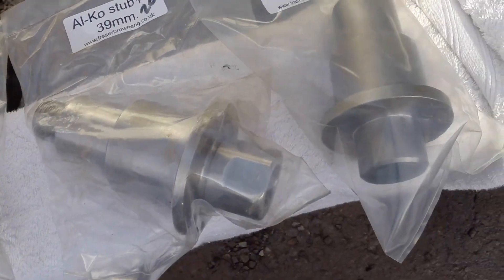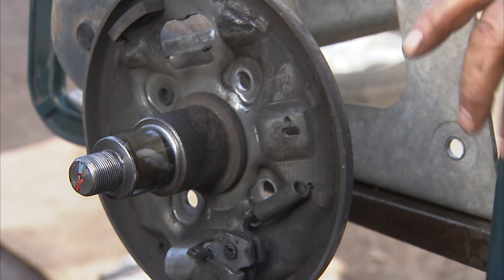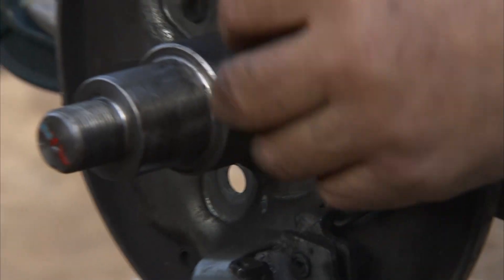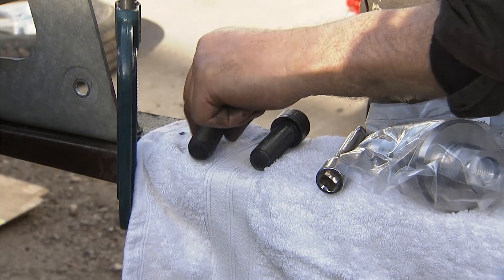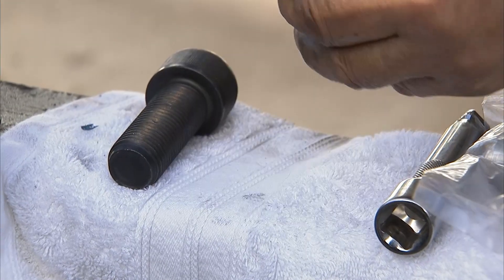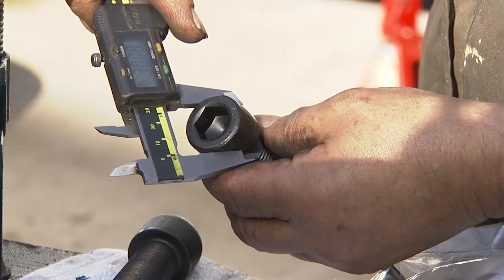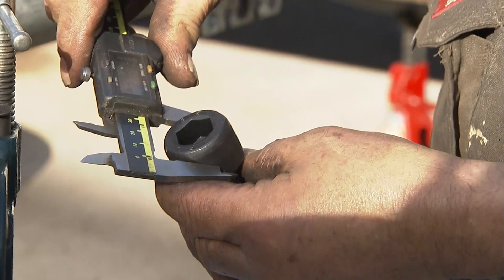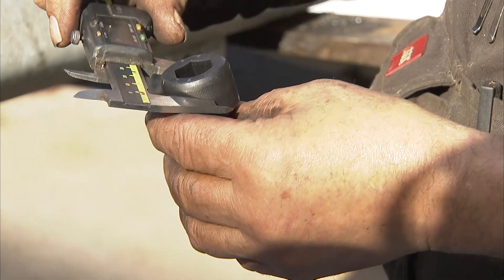Before you have actually removed the old one, it is easy enough to order the correct one. You simply measure the bearing diameter — 39mm — and you have to tell me which bolt you have in the back. The head of this bolt is 30mm diameter; this is the 20mm bolt. The head of the 22mm bolt is 33mm diameter. Because it is flush with the hole you can't get in to use a caliper properly.